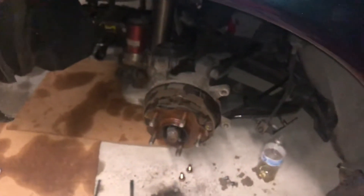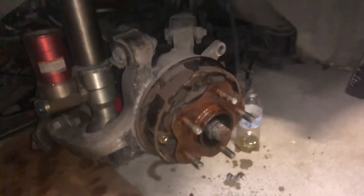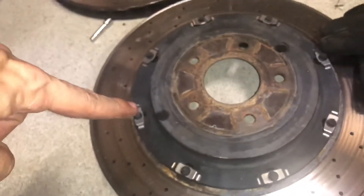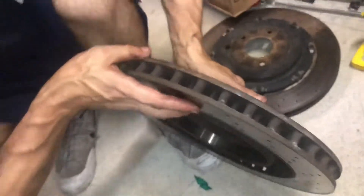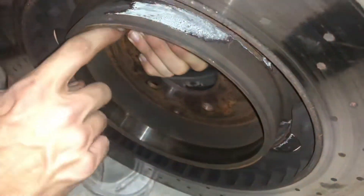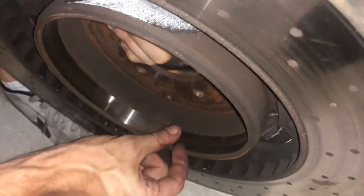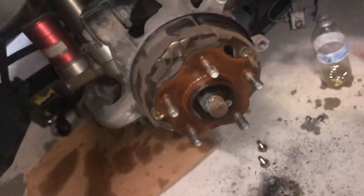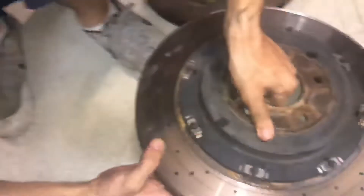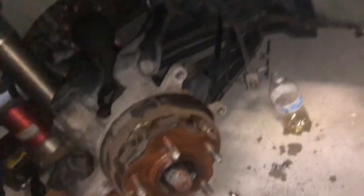For this conversion, we do not have the e-brake adapter — it's on order from JDM Autolink, so make sure you guys give them a like. They're the only people that have the e-brake adapter that you can buy separately. You see this right here? This is the new rotor — different. As you can see, the e-brake right here is a little bit too big, so you get this little adapter. It fits about a three millimeter thickness in here and makes it the same size that would fit around this e-brake. That's all you need — it's just a little piece of metal that goes around it. Otherwise our e-brake's not gonna work right now, which is fine — the car's not moving without an e-brake anyway.